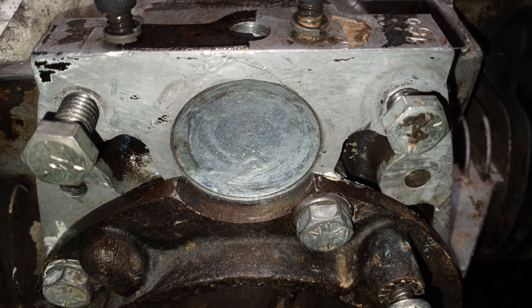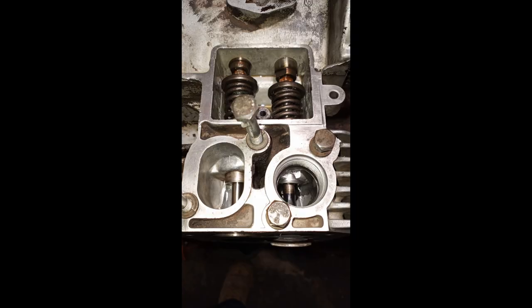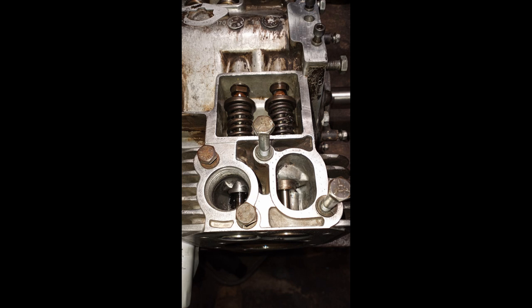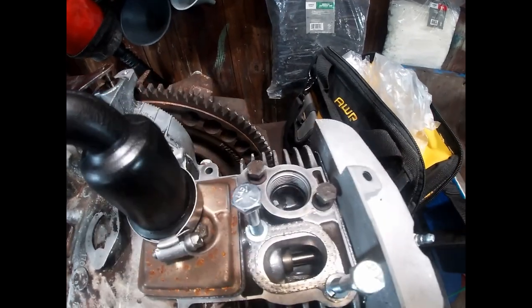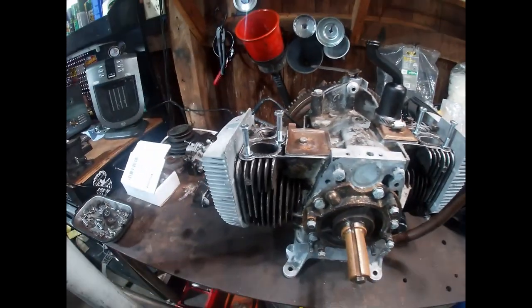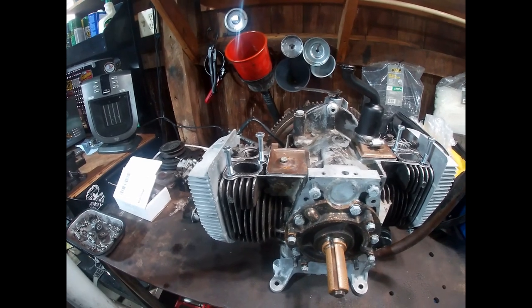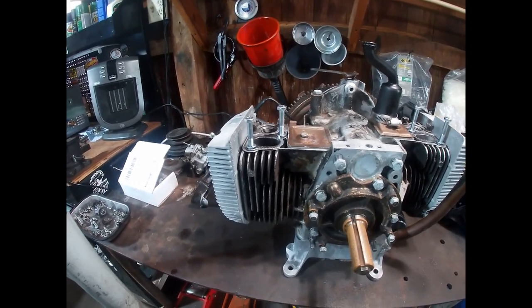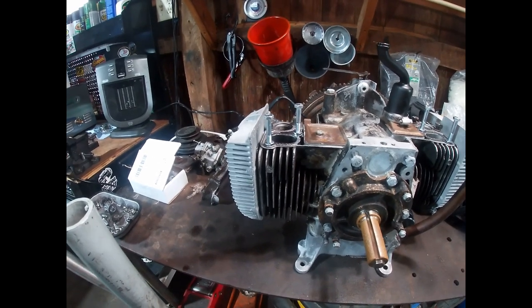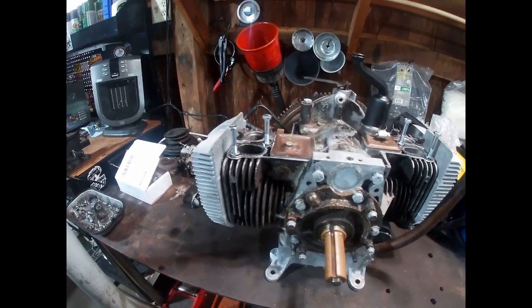Once I got the bearings taken care of, before I put the valves back in, I went through and decarboned all of the ports for the intake and exhaust valves — cleaned them out real good with a wire brush as best I could. When you let that carbon build up and linger, all that does is allow more heat to be generated, making your engine run hotter and less efficient. So I spent some time wire-wheeling the ports out, getting everything cleaned up, and then reinstalled the valves and got them adjusted to spec.